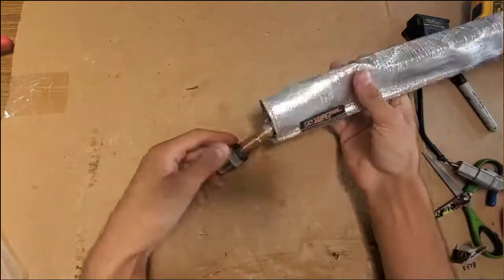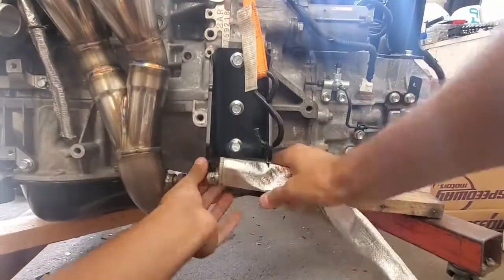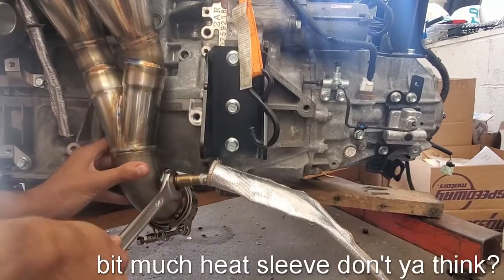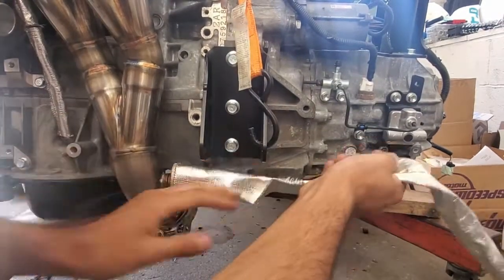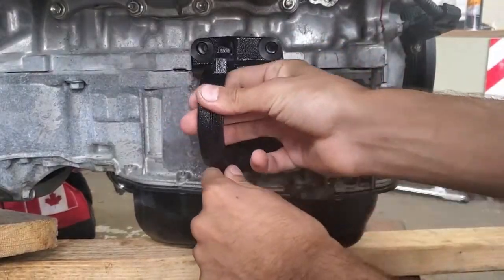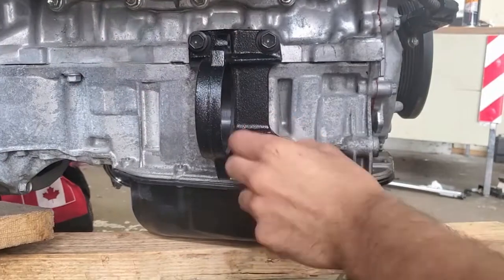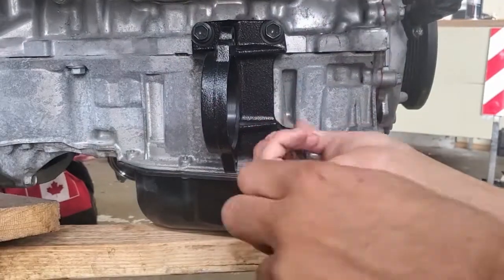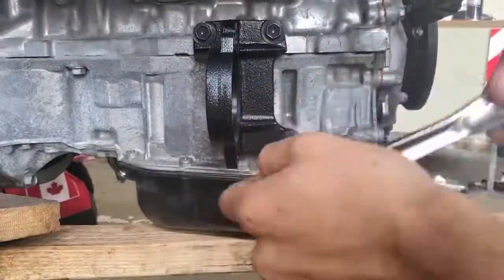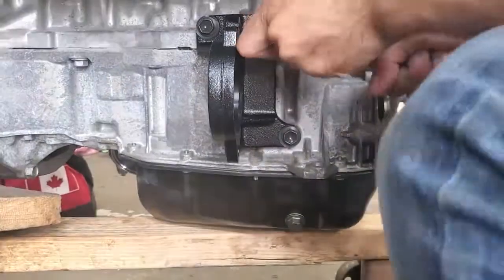The O2 sensor should have some heat sleeving installed. I'm using a wideband so it has a much longer cable. I install this now, but it's better to do so later when the engine is in the chassis as you will need the extra room to install the coolant hose. This sensor came with anti-seize on it, but you have to put some on if it's not already there. The axle carrier bracket can be installed later, but since I have it here I'll install it now — it's about $70 new and rarer at the junkyard than you may expect. It just needs three bolts, and there are two bolts that hold the axle itself to the carrier. The engine is now all ready to be put into the chassis. In the next video I'll be covering the harness modifications, and after that the chassis can be prepared for the engine install.